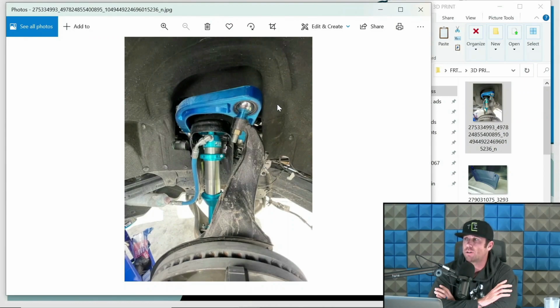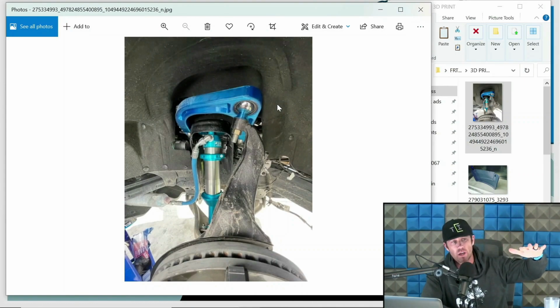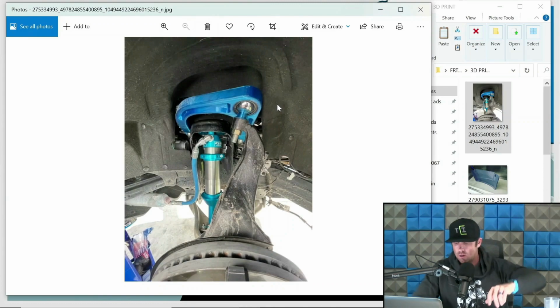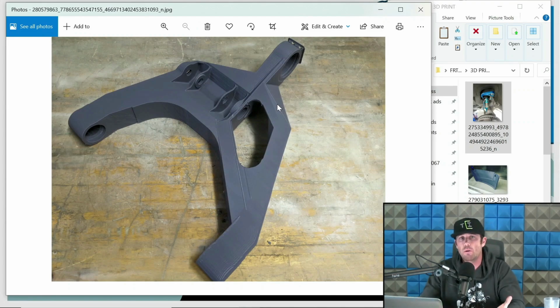And so we have 3D printers accurate enough, but these days, once we go through this stage of, like I was saying, we set everything up to client specifications, we get stuff starting to cycle where we want with the shock package, and then we rough draw in components, we 3D print those chunks, so they look a little rough, like this. This is going to be a sheet metal arm, so obviously it's going to look a little bit different in sheet metal, like you'll see the internal ribbing and some of the overlays, but this is enough to get him to cycle it, etc.